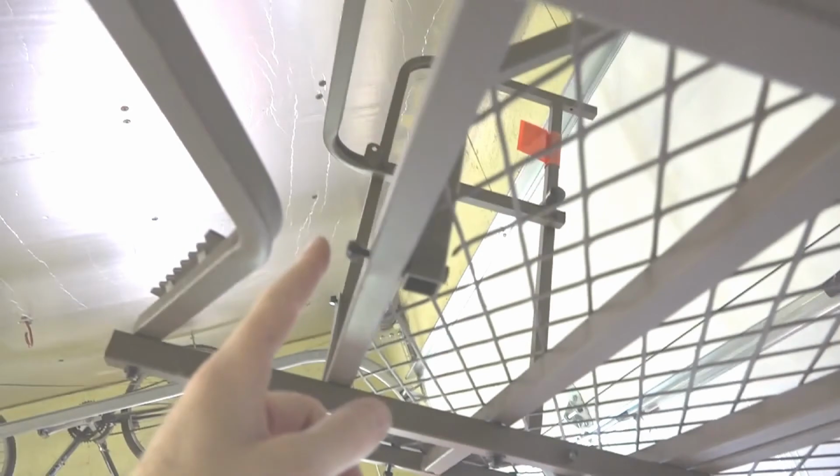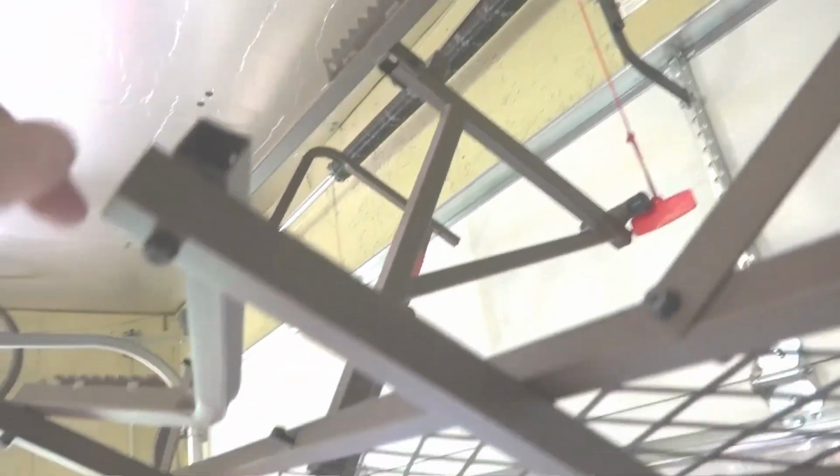I thought it was so you could reach in with a wrench to get in there, but I had this bar in the back here. This is your seat support bar, this triangular thing. I had it in the back of this and it would not line up. So then I realized it needs to go in the front, come down through the hole in the expanded metal, and then your bolt should go in fairly easily.